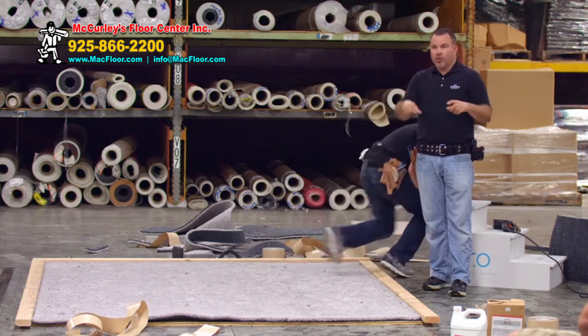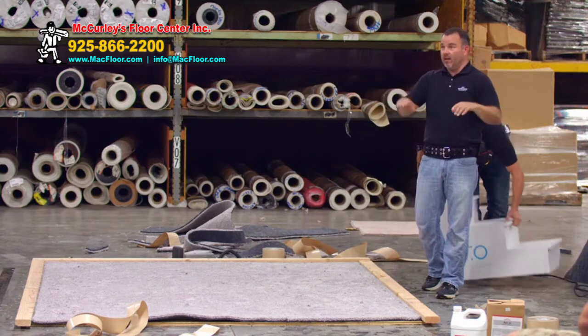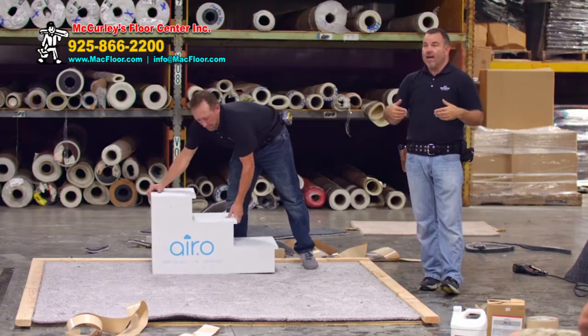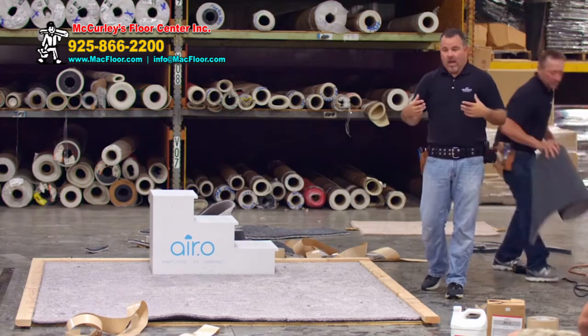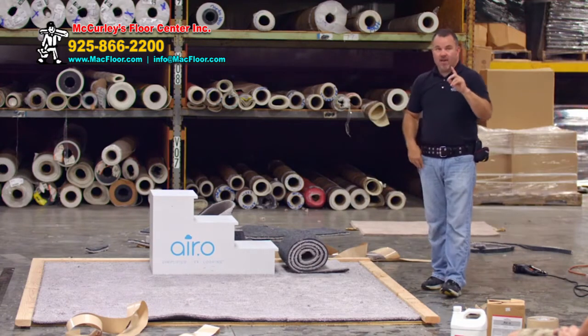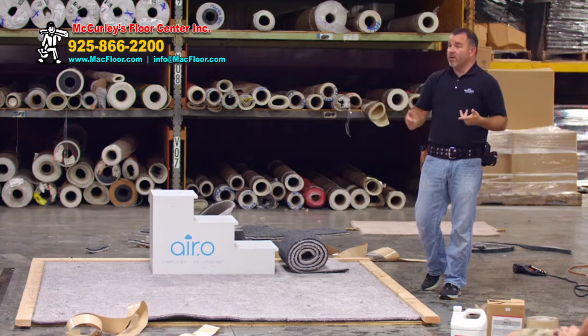For those familiar with our Instaform trims on the laminate wood side, where you can cut three different profiles, you can use that trim as a threshold — put it down, tuck right up next to the edge without a tack strip behind it. That makes a nice wood transition. Any of the metals, rubbers, or tap-downs work. If I have a hardwood floor, I can actually do a turning tack.